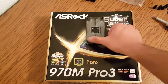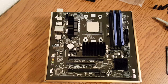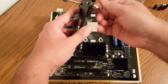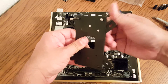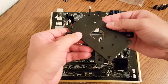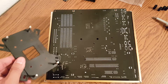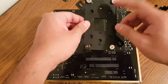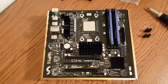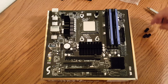The next step is to fit the screws through the custom backplate for the H7. This backplate is designed to fit both AMD and Intel CPU sockets, but for this build we're using the AM3+ socket type. These four screws just need to be installed in the four corners. The easiest method is to flip the motherboard upside down and sit the backplate right through the motherboard.